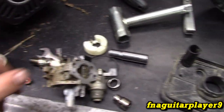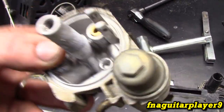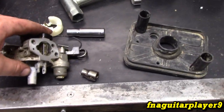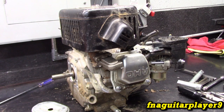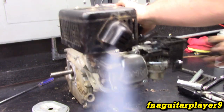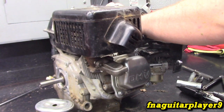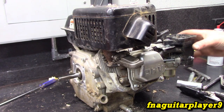He apparently tried to take it apart to clean it and it just wasn't happening - common problem with this. I'm going to try to run a little piece of wire through it and clean it the best I can with it still together. That was probably the whole problem with it - the jet's probably clogged up completely. Alright, let's just see what happens. I'm going to spray a little carburetor cleaner and run it, then we'll have to go from there and see if it will run on gas.